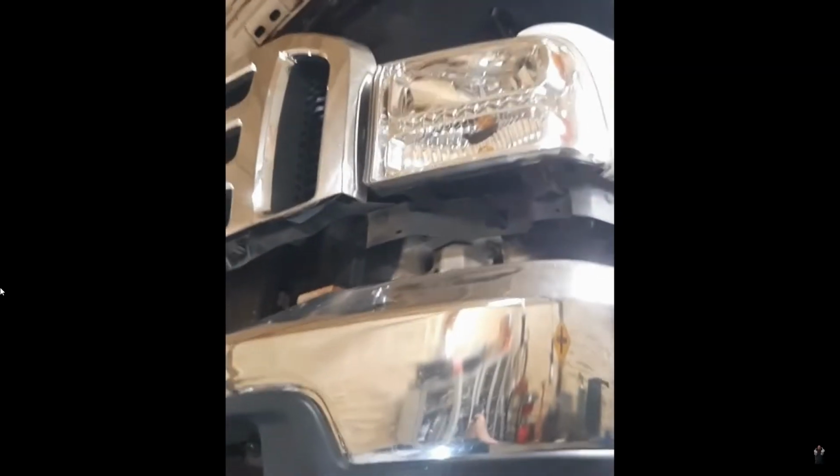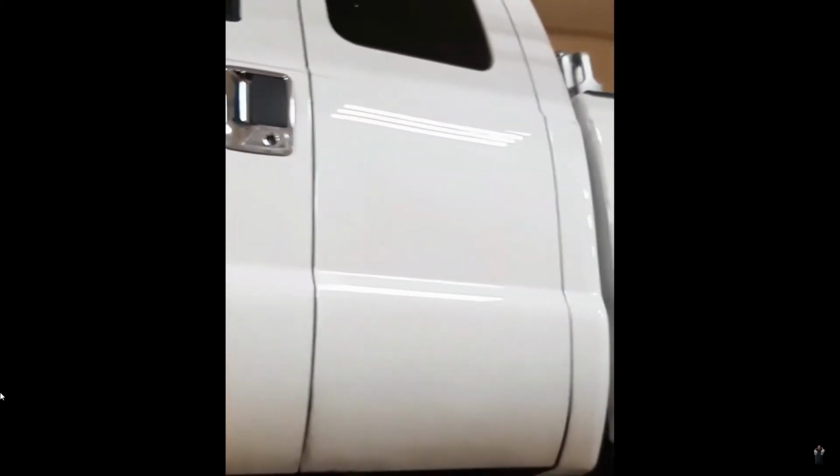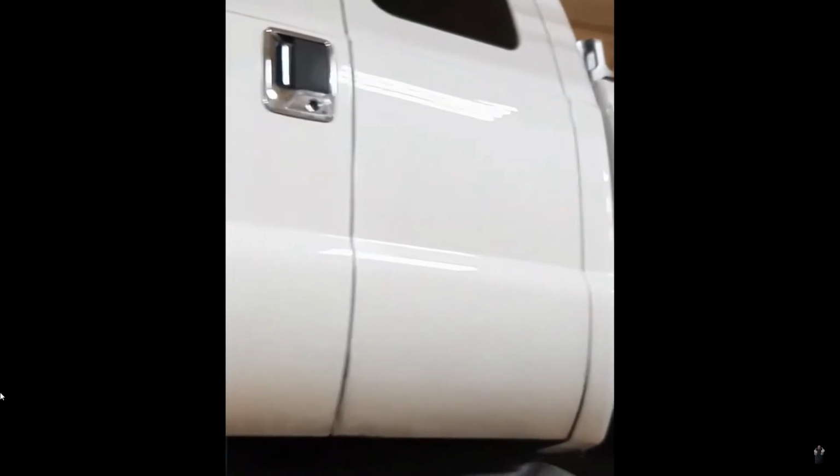If you're doing this job on this F350, '04, you got to lift the cab. Obviously, you can see you got 4 blocks in there, so we had to get it pretty high up. You've got 6 mounts. This is an extended cab, not a 4-door. All the other videos I've seen were 4-door, so they had extra bolts. They had 8. This only has 6. This one's not that bad to do.